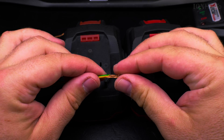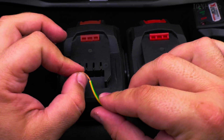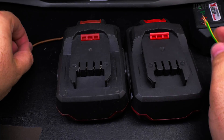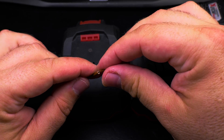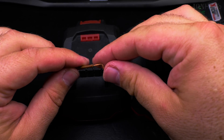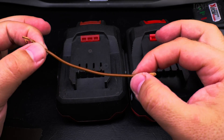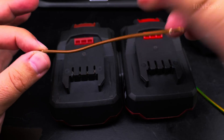I'm using just electrical wires here, but you have to be careful — these wires might overheat pretty quickly depending on their thickness. You won't need to keep the wires connected for long. Most importantly, connect plus to plus and minus to minus, always like this. The order doesn't matter here like it does with a car — basically 3 to 5 seconds should be enough.